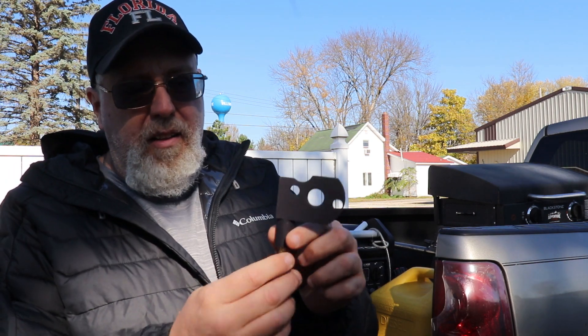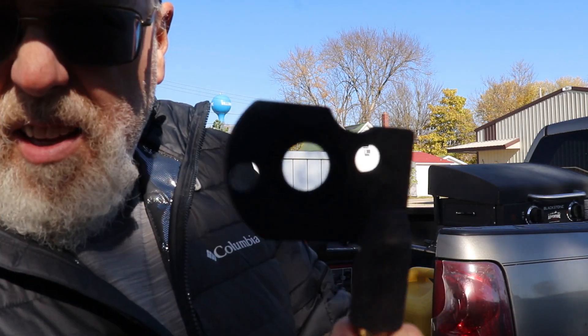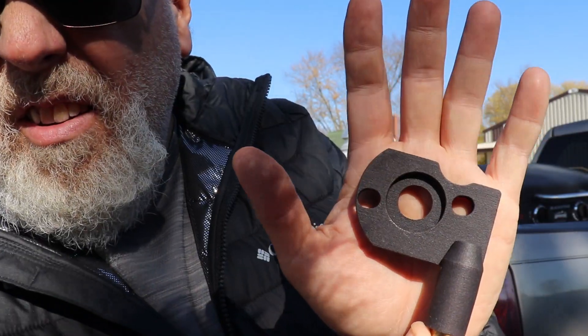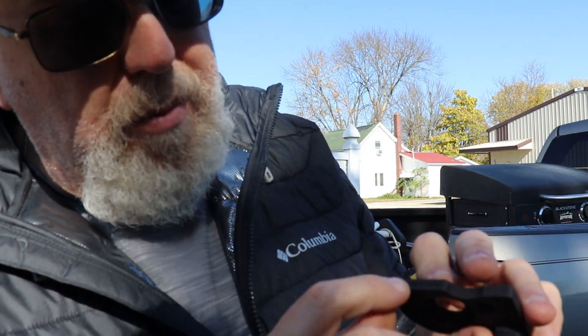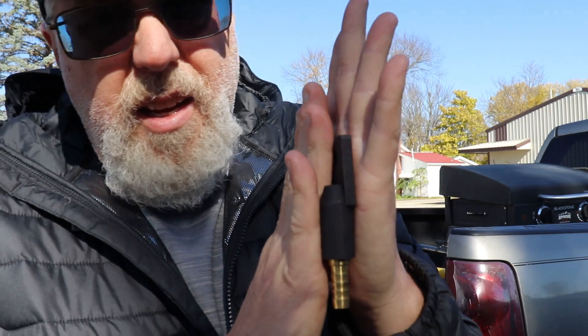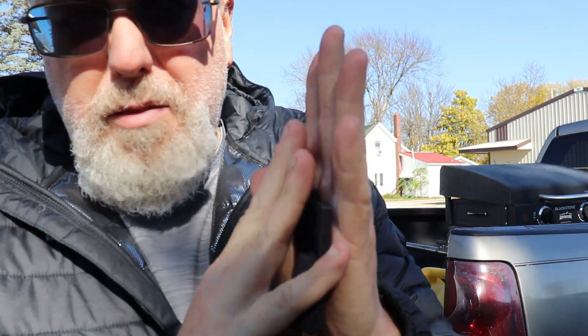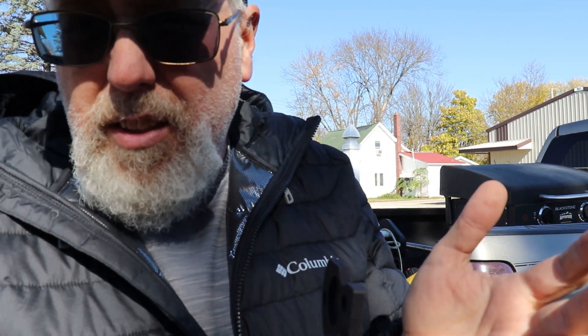Another nice thing about the Nash is this is where the fuel is actually introduced into the airstream of the engine, and as you can see it's only a quarter of an inch. There's no real modifications that need to happen inside the case. As you can see, there are two different sizes — the larger side is even stamped on top saying 'carburetor side,' so this side faces the carburetor, and the other side faces your air box. It just squeezes in between the two, offsetting your air box by a quarter of an inch. That's the only real modification done to this motor.